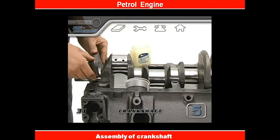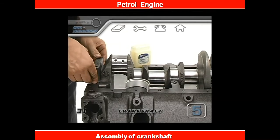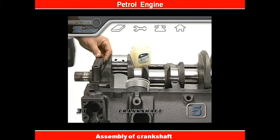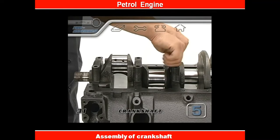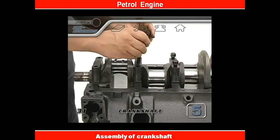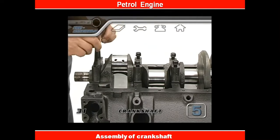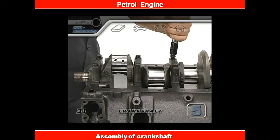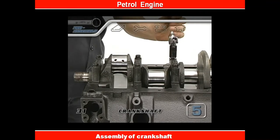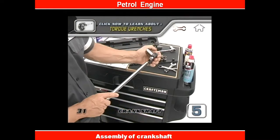As you put the caps in their places, follow any stampings that you made during disassembly so you don't mix anything up. If you need to tap on the caps to get them to seat, be very careful not to tap too hard — if you do, you might squish the plastic gauge just a bit and that would give you a false reading. Every bolt that goes on the engine should have some kind of lubricant on it before it goes in. For this procedure, the main cap bolts get engine oil on the threads. When all the bolts are in and hand tightened, you'll need a torque wrench to finish tightening them to whatever spec is listed for your main caps.